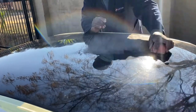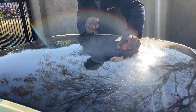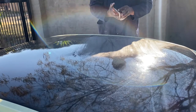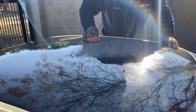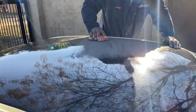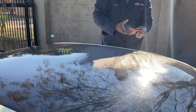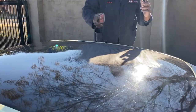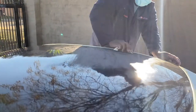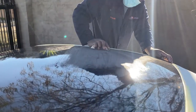So it's very important to follow the instructions on the paint and stir it properly. Because some of the guys, they don't stir it properly. Then you get your hardener and thinners on top of the paint, and at the bottom is just a normal paint. As you pour into the gun, the first thing that goes in the gun is the hardener and thinners, and then what comes after is the paint. So if you didn't mix it right, you're going to have this problem. Okay, makes sense.